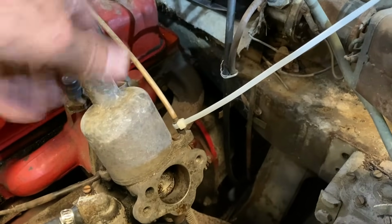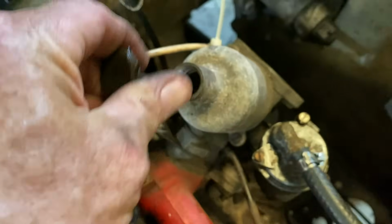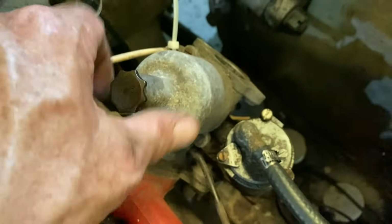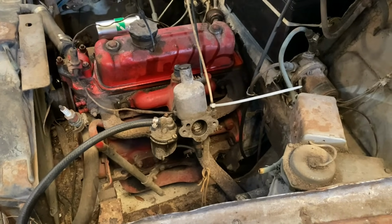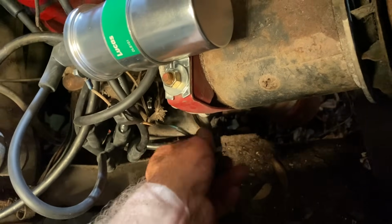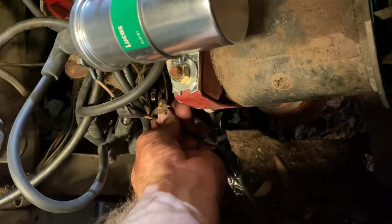Get some oil in there. Oh yeah, now it's full. But this will help. It'll run a little better, especially cold with this, and accelerate better in theory. Wow, it's rolling over like there's 0 compression. Smoking gun. We didn't hook up power to the points of the distributor, so we'll do that. Now it'll run.